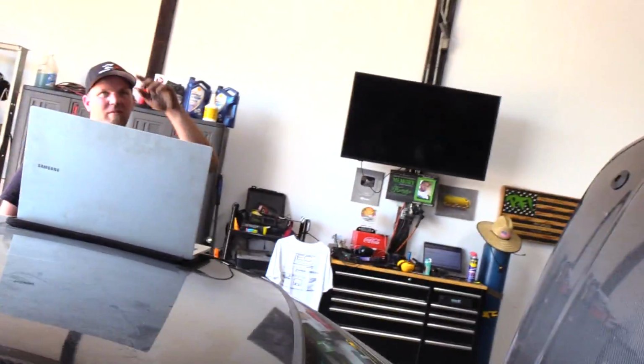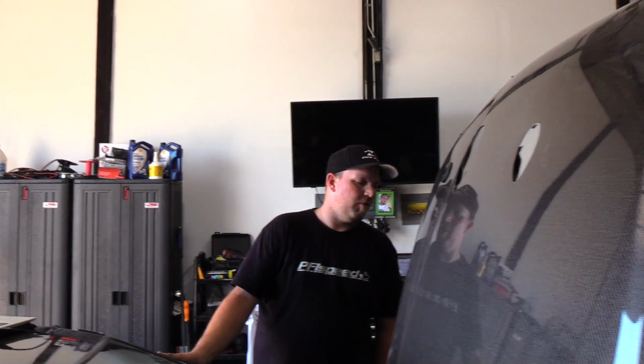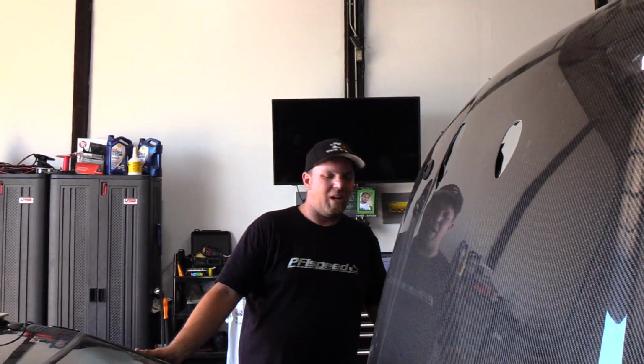We were on a pretty time sensitive crunch on this thing. So we got pretty creative on the wiring harness. We ended up using a V8, the Pro 600 V8 harness. It was the Ford one for the right firing order. So it was like using a universal four cylinder harness. But this doesn't come with the coil harness.